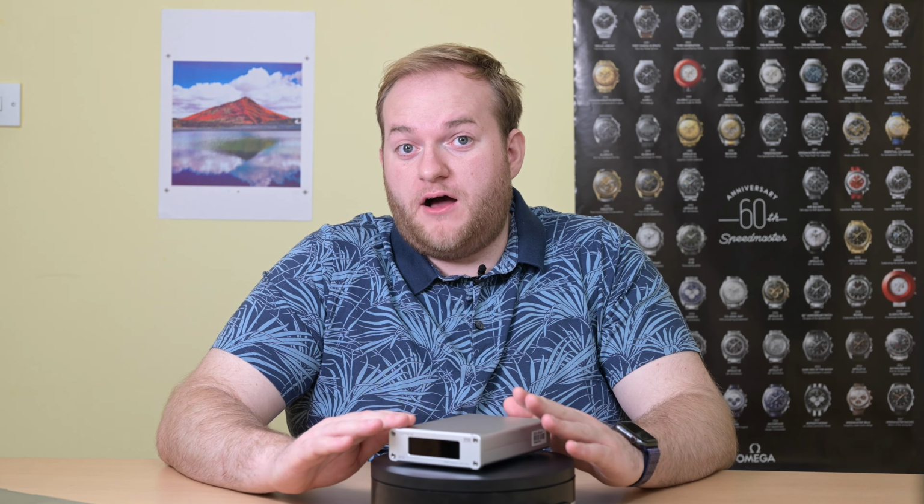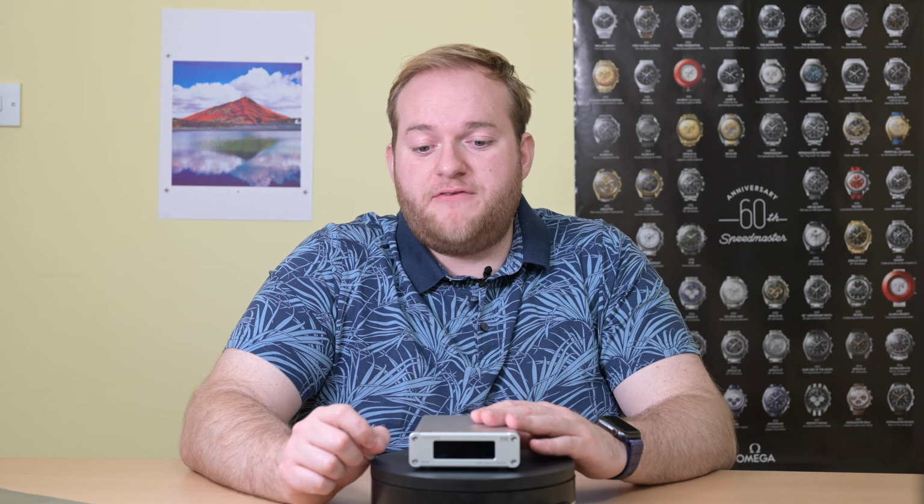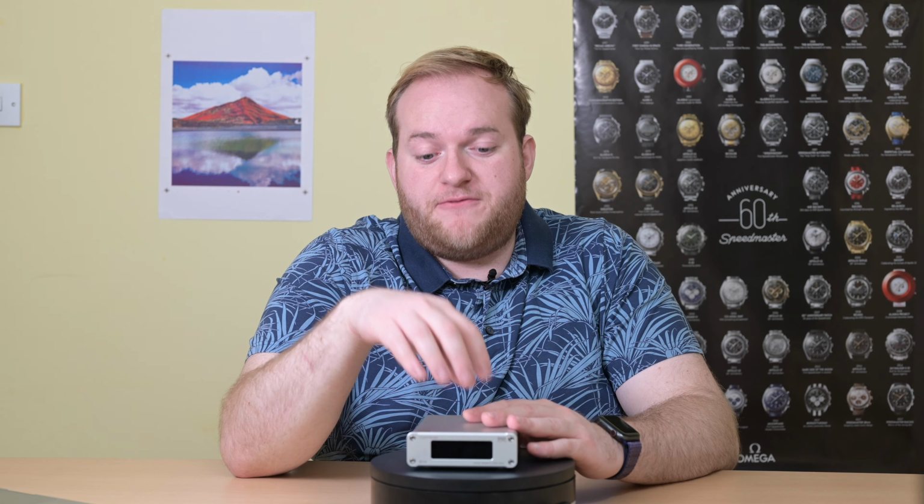Now, some hi-fi equipment already has a digital input, so you might be using an optical cable from your PC or your laptop to that hi-fi, in which case you wouldn't need such a thing. However, if you're taking the audio output from a 3.5mm jack and plugging that into your hi-fi, that's where you can really benefit from these digital to analog converters.